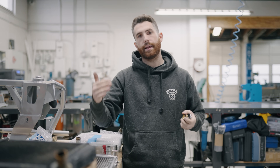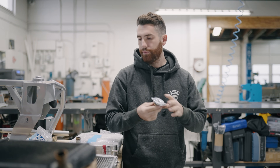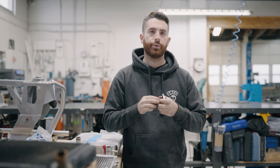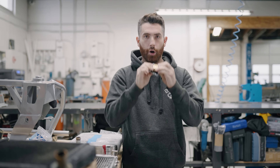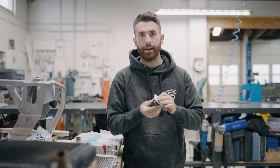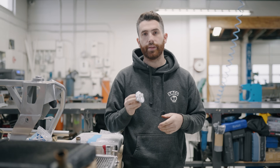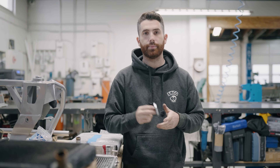Another piece of the puzzle in heat transfer is pressure. Water boils at 100 degrees Celsius, but we can raise that boiling point with pressure. The radiator cap has a spring in it to hold a certain amount of pressure before allowing it to escape. The more pressure you can contain within the system, the higher the boiling point will be. With a blown radiator cap — where the spring or seal is gone — you can't hold as much pressure, the boiling point drops, and you'll overheat more easily. Changing out the rad cap is a really simple, cheap maintenance step, so make sure it's in good condition before chasing bigger problems.